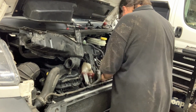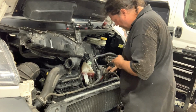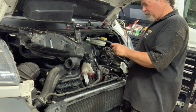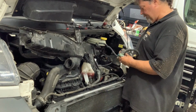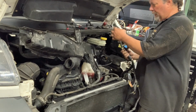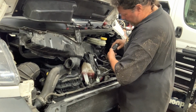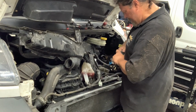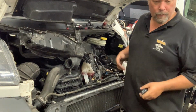Okay, that's back. Here is our almost totally free wiring bundle, which would contain the passenger side fan, resistors, and relay, which is already on here, but I'm going to disconnect this and replace it because I'd rather use the new relay. And our driver's side resistors, relay, and power module. Let's do that. Maybe I can show you. See this? The way the relay comes out is a squeeze here that releases a tang, and then it just pops out. And it's just a 4-pin relay like we've had since Ben Franklin was horny.